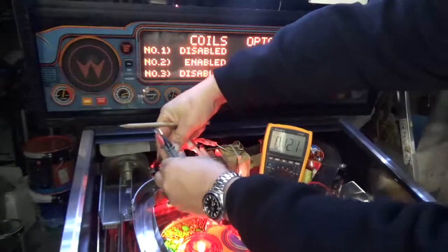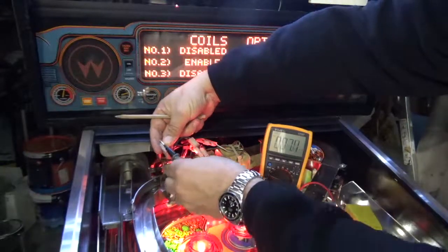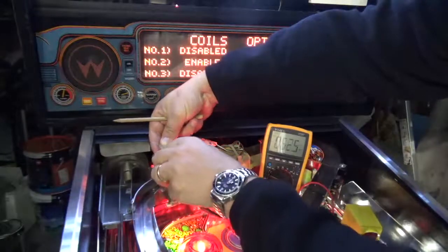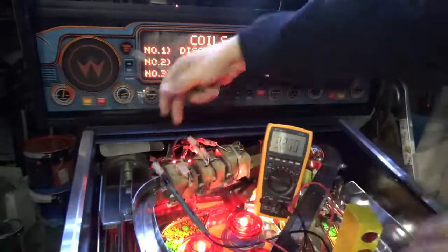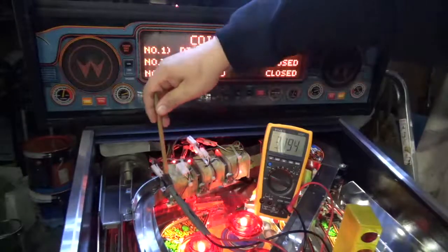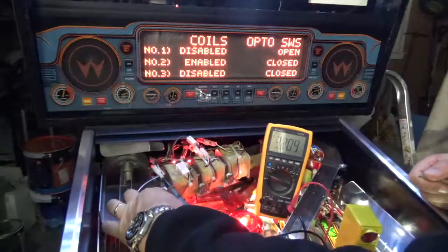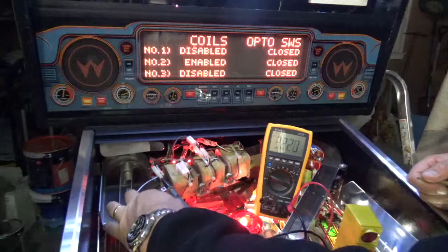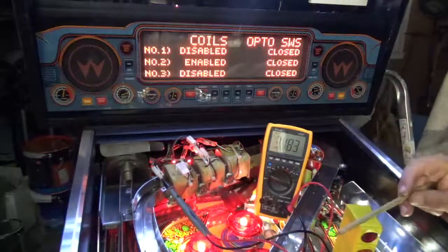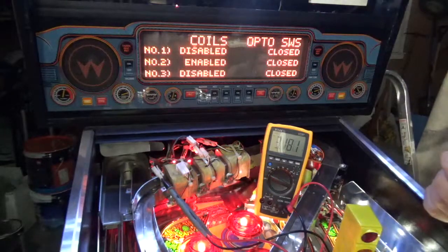So take the plug out. This is the one that looked like it wasn't firing. And we'll plug this in and have a look. So now incidentally we're getting the 3 volts, but when I pulse this, let's see what happens. Absolutely nothing when I interrupt the it. You can see the opto is working, but it's not causing any extra volts. So I think there's a problem down below on the transistor on the accelerator board. Let's go and have a look there.